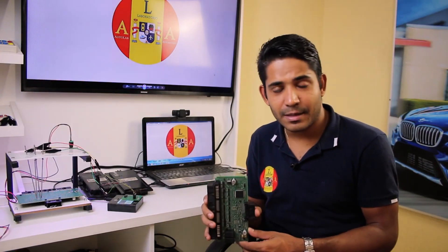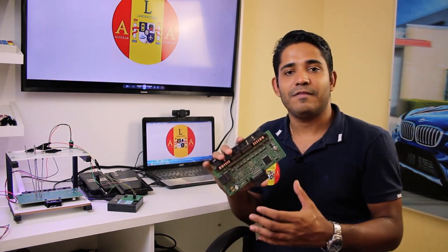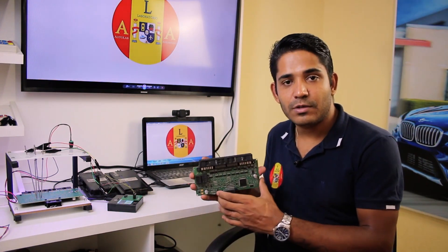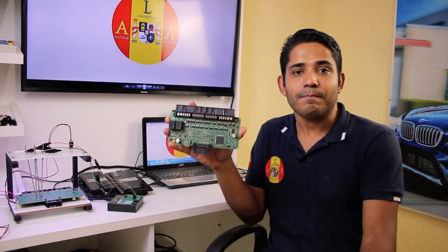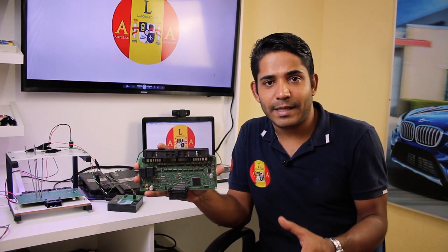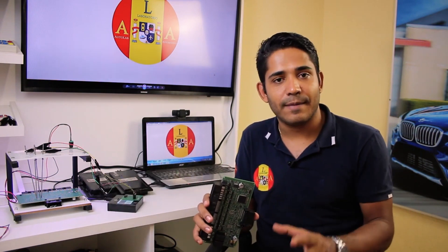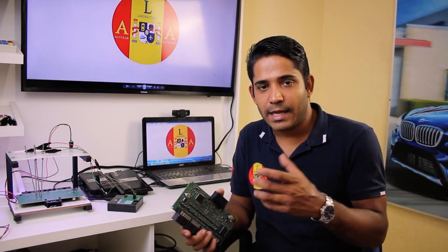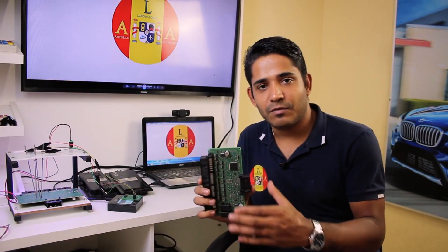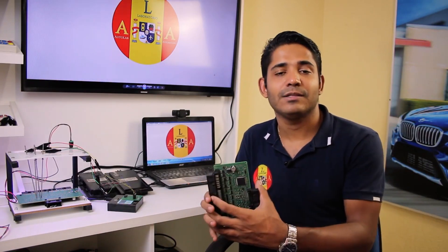You'll see how to perform the entire repair and programming process. When it comes to battery replacement, many mechanics make the error of changing the batteries on these cars — which have a high level of embedded electronics — without using the auxiliary cable made according to each automaker's specification. This auxiliary cable is responsible for keeping the system powered during battery changes, thus avoiding the loss of data from various electronic modules.